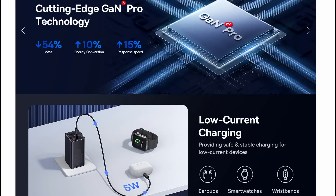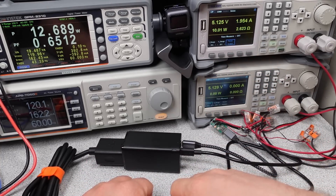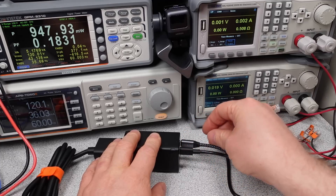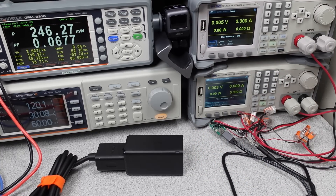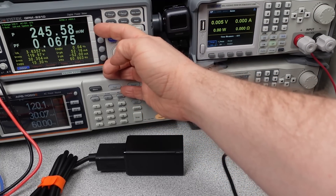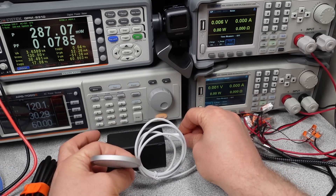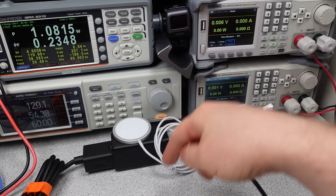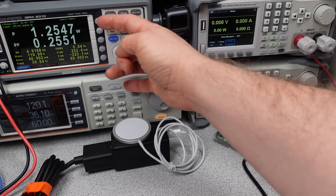Here is where they actually did make a correct claim in the marketing material - the renegotiation is faster. Sort of. The issue I had with it is it is twitchy; it repeated the renegotiation after about 10 seconds. It had it and then it didn't, but still it is much faster than the older model, so I think that's the GAN 6 meaning: better USB negotiation. Once powered up, the idle power usage is on the higher side - this is not as good as the GAN 3 counterpart. With almost nothing plugged in, like a cable or an unused charger, the power consumption shoots up to over a watt, multiple watts with just cables plugged in. This is unacceptable. I don't unplug my cable every time from the power adapter, and I doubt most people do, so this is strike 3 - this one is out of the running for me.